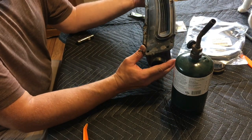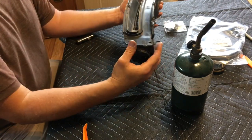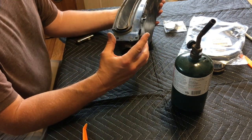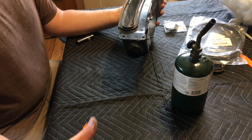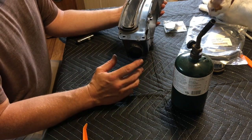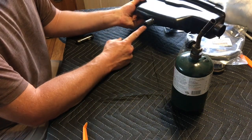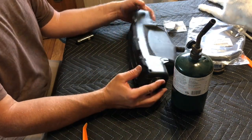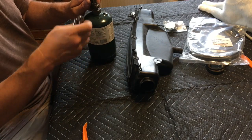But here's the problem I have with this thing. This lets fresh air in. It sits against the dash like this. Fresh air comes in, it goes out the vents in the hood. If you got these closed, then it's fresh air. If you got them open, then fresh air comes out those vents. If you've got them closed, then when you have the defroster on, the defroster comes up through that plenum, and then the defrost will go out the vents. And that works great, but when you have this open for fresh air, some fresh air is gonna go out the bottom here too, and go out down through your defrost pipes and out by the floor. So maybe that's a good thing. Maybe you want it out by the floor, but it's not the most airtight system.